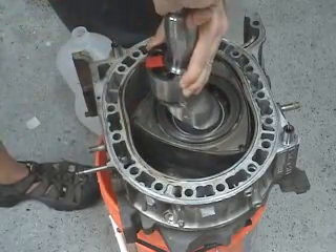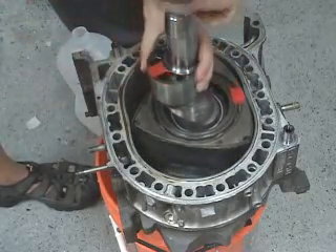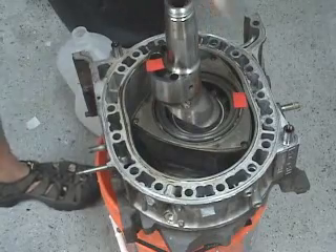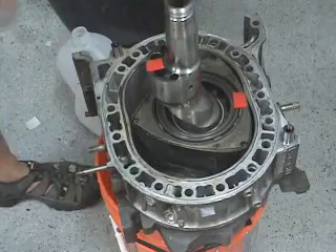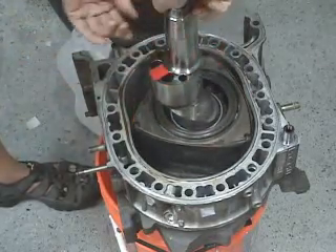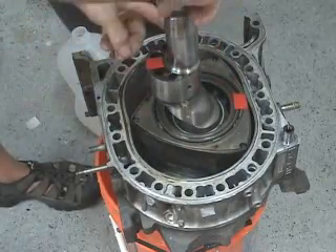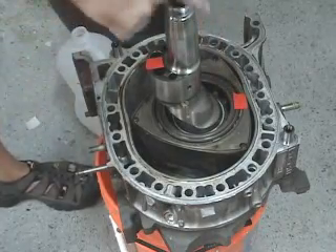Two revolutions, a third compression cycle, two thirds of the way. Three complete revs return to start. So you can see there is a one to three relationship. So for every time the E-shaft goes around once, there is one combustion cycle per rotor.